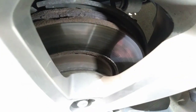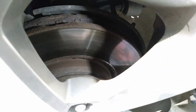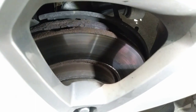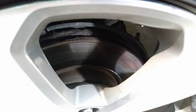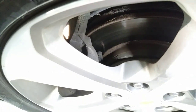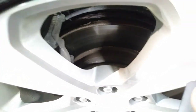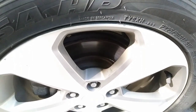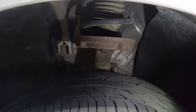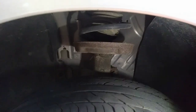Also, check your brakes. Mine has a slight discoloration which means it's glazed, and it's been screeching sometimes when I'm driving. I'll be looking to do brakes later. It's getting close to due time to do front pads and rotors — I already did the rear pads and rotors a few months ago.